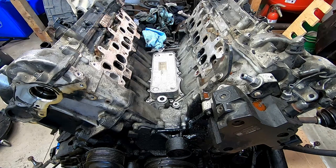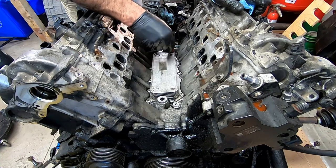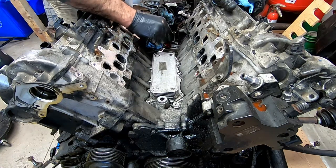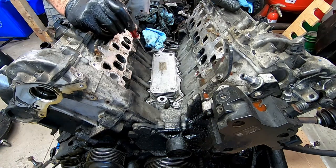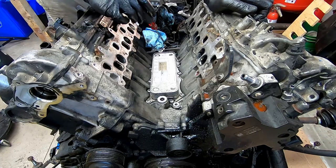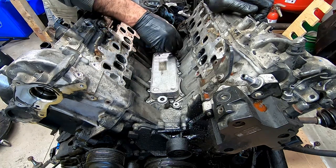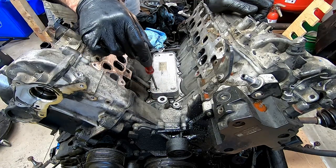One thing I wanted to show you guys is that the valley here has an oil drain right there in the back — it basically goes right into the back of the bottom of the engine, and that in itself has a drain that goes straight down. I understand why a lot of folks say when this stuff fails and starts leaking oil, it presents itself as a rear main seal — because that drain is just going to put oil right at the bottom of your transmission. So if the oil cooler seals fail, it should not be pushing oil out at the front. There are drains at the two ends of the valley, so everything is going to drain down at the back. So everything I've got going on here is not actually related to the oil cooler seals.